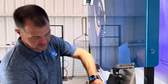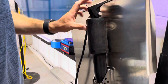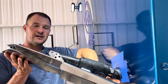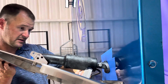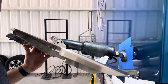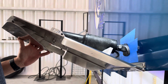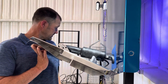I need to move the pin, not the whole bracket. I'm going to slide this pin out and go back one and down one. Now putting everything back up — that's a little bit better. I'm getting closer to that one-inch mark. I can rotate this up to get me there. Checking that again with my angle finder, calibrating on the imaginary bottom of the boat and holding it on the tab — that gets me to about 21 degrees. That is an acceptable number.